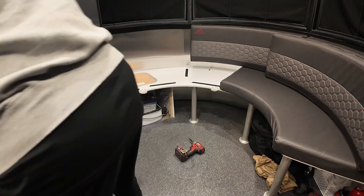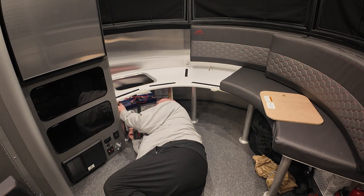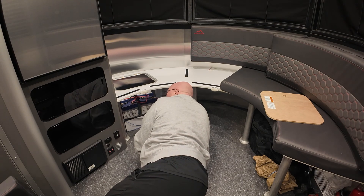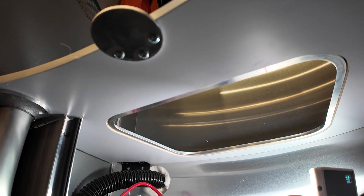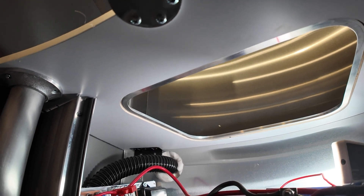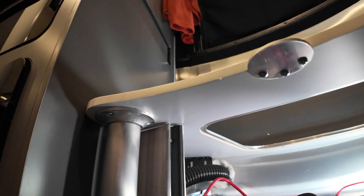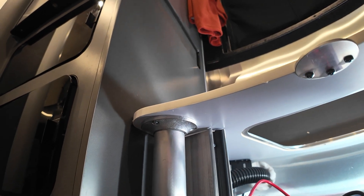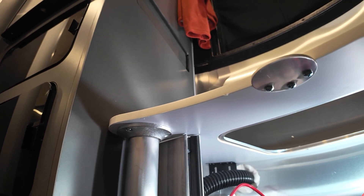Pull the cushions off and the cover for the battery box. Now, there is a tough screw in that leftmost column — in the back left corner, you can't get to it with a drill or an impact driver. You're going to need an old-fashioned Phillips screwdriver. The other tricky one is this black bracket above that vent tube in the upper left of the battery box — I used my drill driver with an extension and got it out fairly easily. But for this one, you're going to need a thin-handled Phillips screwdriver and just be patient. Turn it an eighth of a turn at a time, whatever you can get.